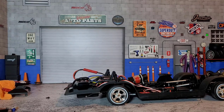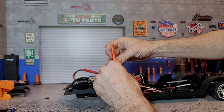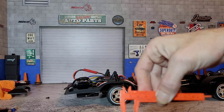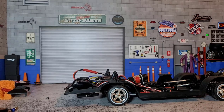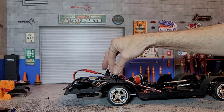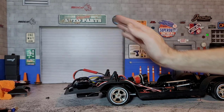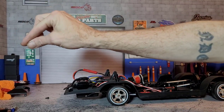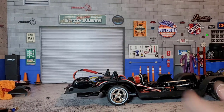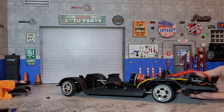Yeah, go. Perfect. 9 millimeters. Now, the reason I'm doing it only 9 millimeters is because you run into conflict on the interior, little buckets in the back window. You can't really swing these arms too far back because you start getting into conflict with all those. And I want to make sure it's just even on both sides. We've got this side exactly where we want, 9 millimeters.